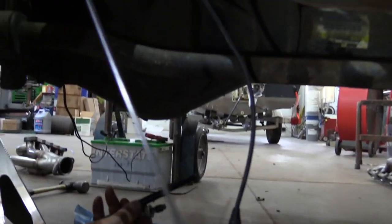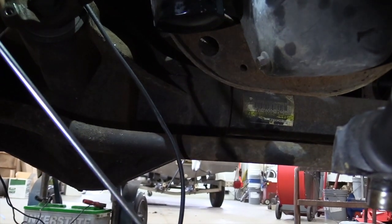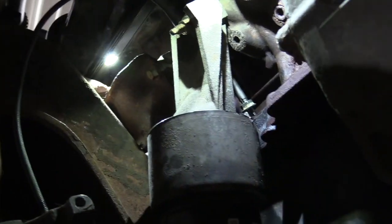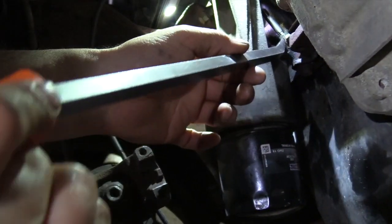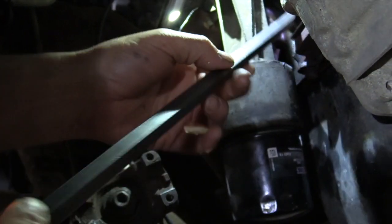What I did is I went in that hole with a screwdriver — I got a long screwdriver here. There's no windage tray or anything to hang it up, and I kind of heard it hit on the bottom of the pan, so it's down there in the bottom where it's not going to cause any issues. So if you don't get it out, it's not a huge deal. But the biggest thing is getting this rusted part up here out. That was in that hole, and what I did is came in with a pry bar — I had the drive shaft off and you've got enough room where you can actually work it. You can come up and pry back and forth on each side. Put some penetrating oil on and eventually you'll get that out. Just don't tap it in quite as far as what I did, and that'll save you having to pull a lot of stuff off that engine, like that oil cooler and that whole assembly.